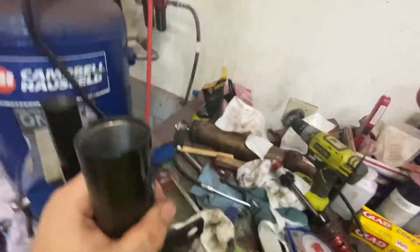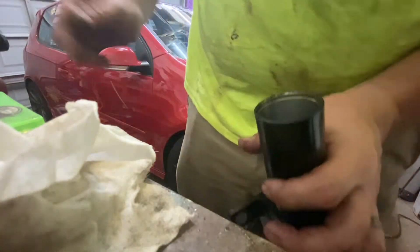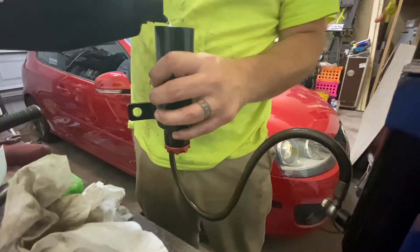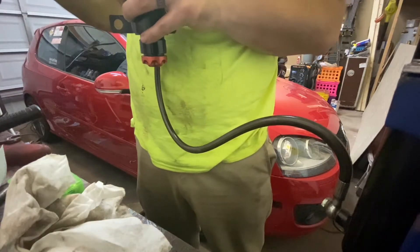The idea is that we're going to fill this hose completely. Elevate this so it's not overflowing but you're still filling it up, and just dump oil in. Once we have this area topped off, we're going to put in that little divider for the nitrogen charge. I'm going to take our shock fluid.